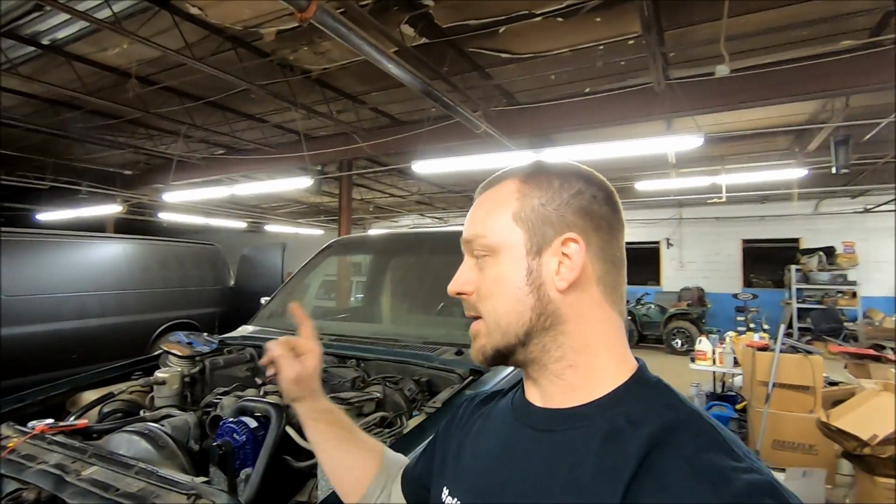All right, now, my generic theory, what I like to go by, is one run of positive wire for every power source you have in the front of that vehicle. Now, batteries and alternators are power sources to me. So if you've got a battery up front, well, that's one run of wire, and you got an alternator up front, that's two runs of wire.